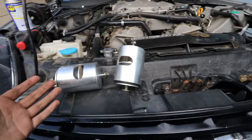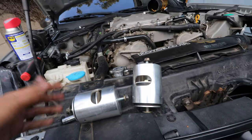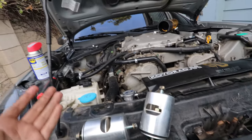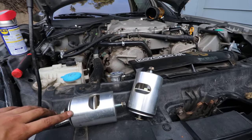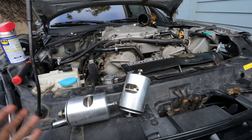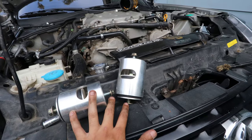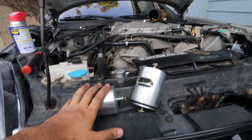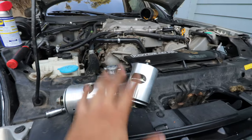These are going to be the motor mounts I'm running — I got these off of Static Martin, shout out to him. The cool thing about the Z1 Motorsports ones is that they're polyurethane so they last a lot longer. The way they're designed they're always on compression. What kills the OEM mounts is they work on tension and compression — when the engine is on and off load it's pulling one way then compressing the other. These mounts work on compression both sides so they won't wear out as quickly. They're a little stiffer than OEM but it shouldn't be too rough a ride, and they'll be a great addition to the track build.